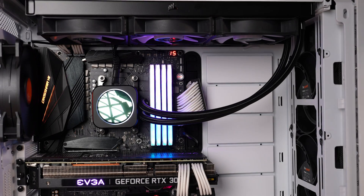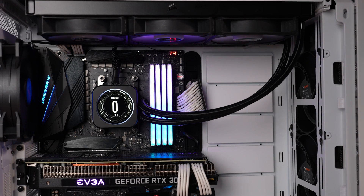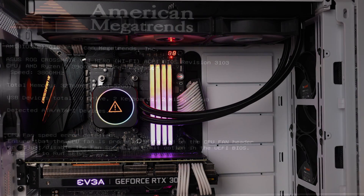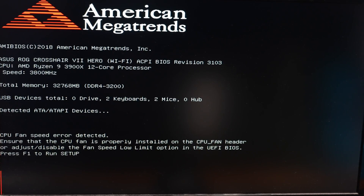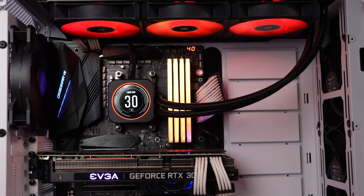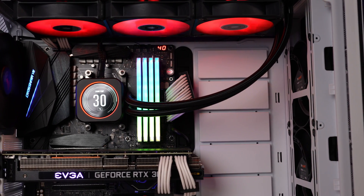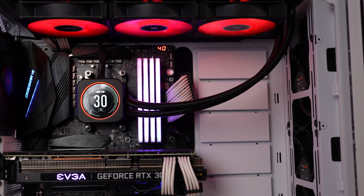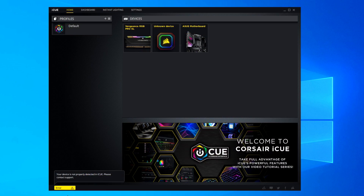What do we get? A really cool display graphic — and is it going to boot up? The fans started spinning, that's good. I see liquid temp, and oh, an error sign. So I've got a couple of problems, and as my motherboard reports, it's detecting a CPU fan error. Remember how I mentioned connecting that one-pin connector to the all-in-one pump header? You actually have to connect to the CPU fan header, or your CPU will appear to be uncooled from the motherboard's perspective. That's very scary, so make sure you get that right.